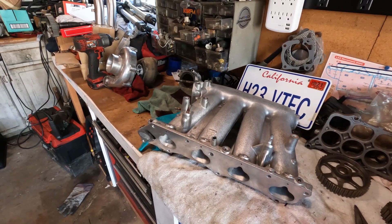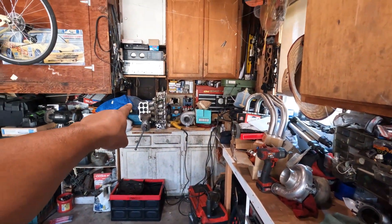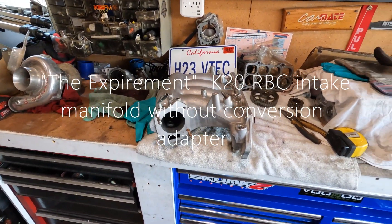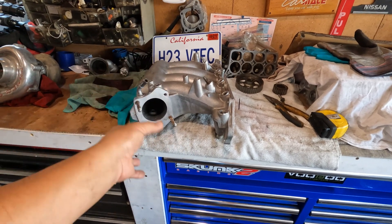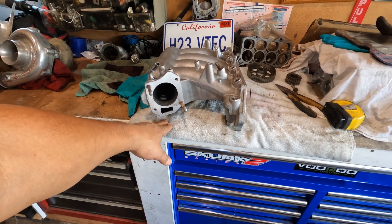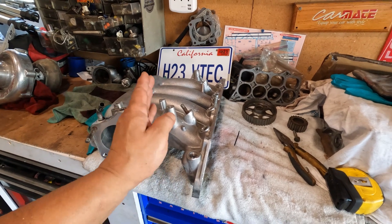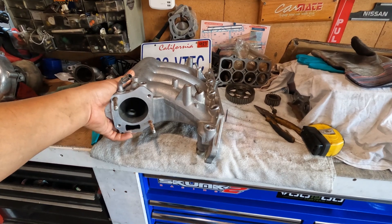This project is only for research and development. I have the H22 intake manifold right there, and this is the RBC. Everyone knows that if the RBC is used for an H22 swap, it tends to lean downwards and creates some interference on the rear T bracket right about here. My intention is I don't want to use the adapter plate, and I also want to bring this up a little so it will sit up like so — at least that's my plan.